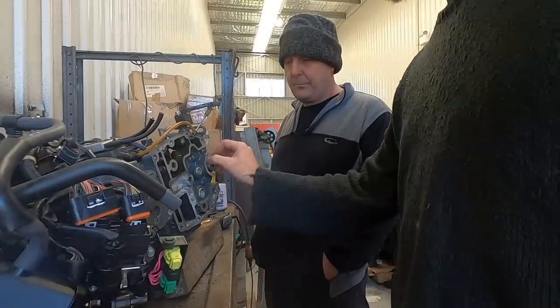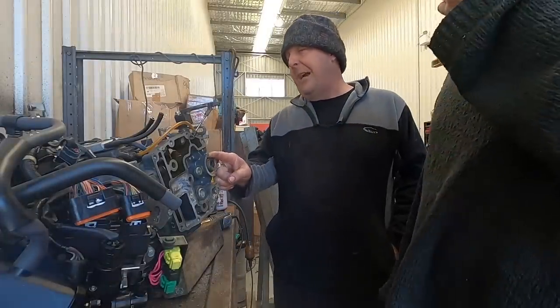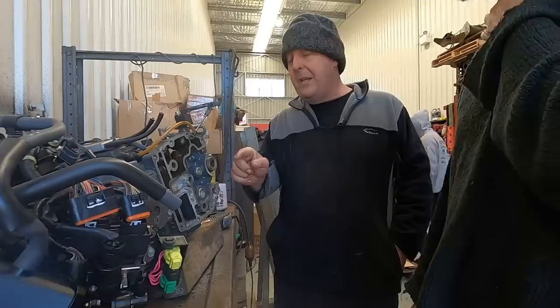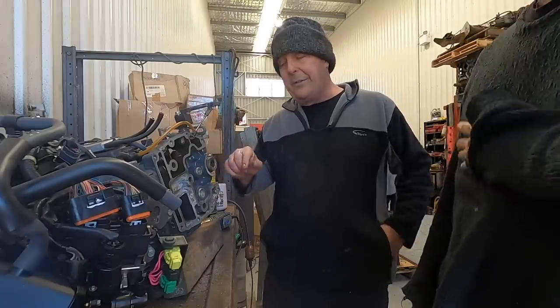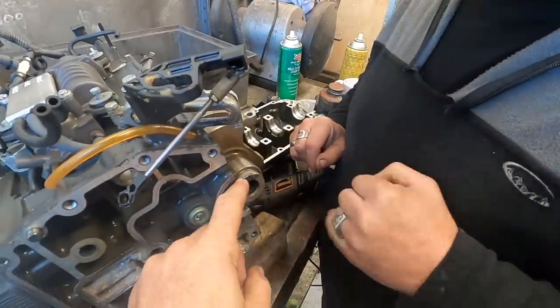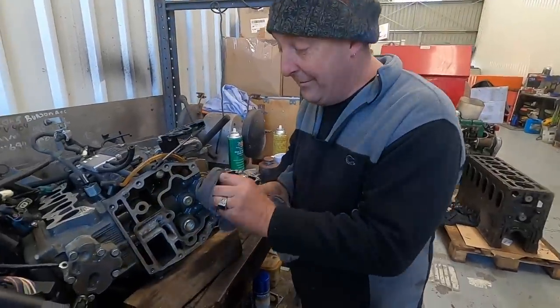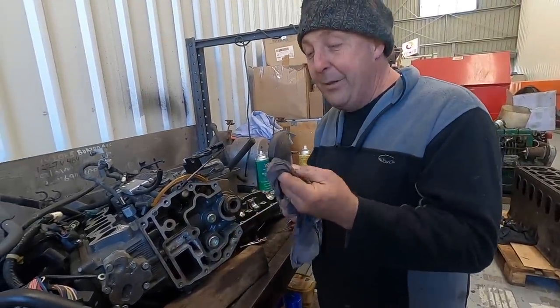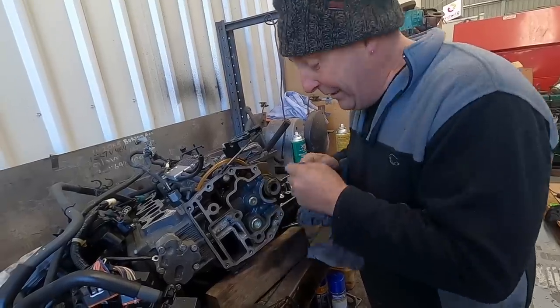Now, do you put any Loctite? I usually put a little bit of either aviation gasket goo or 515. And it gives it a bit of something to slip on. Yes, it's a lubricant to start with. But also, considering we've got some little bits of corrosion there, it'll just fill up the little pockets, I reckon. Yep. Sounds good. So this is the patented Adrian Tanner technique for speedy sleeve, not the textbook one. Put the thinners on the rag, sniff that, and then wipe it on here.